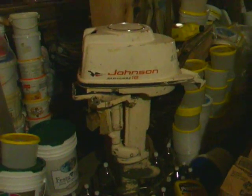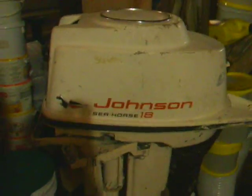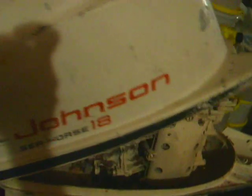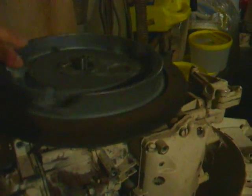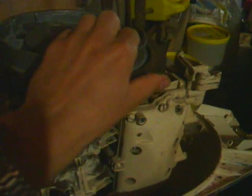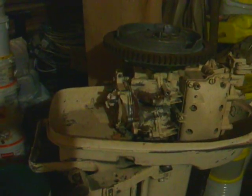Here's a quick look at my 1959 18 horsepower Johnson, model FD13, in the basement. Got a spare 59 10 horsepower hood here with all the trimmings. I got all the parts of this in a box in the garage; it's not running at the moment. The compression on this doesn't seem too good — one cylinder doesn't seem so good, I think it's the top one. So if anybody thinks it's a good idea, I could take the Evinrude power head off and put it in this.